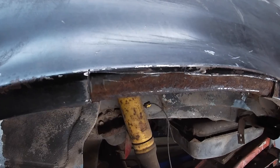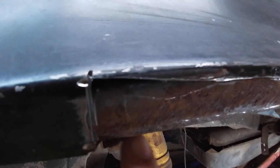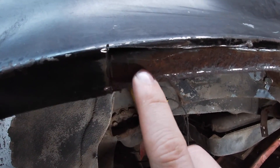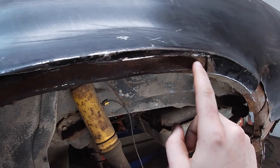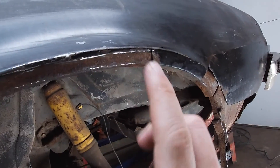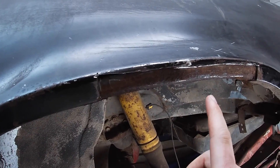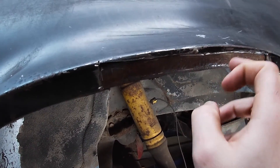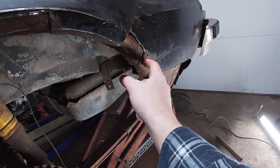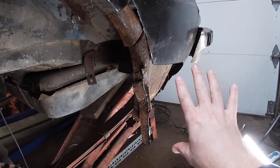I don't know how well you can see, but we have taken off all this stuff and it actually looks pretty good right above the seam line right here. There is some surface rust along here — we'll check it out. We'll probably end up sanding this down, but I think everything should be okay to proceed with, because it's all still really, really good metal. Now down here, this whole drop pan is probably going to be replaced. There is some rust here at the edges, so the drop pan is probably pretty much shot.